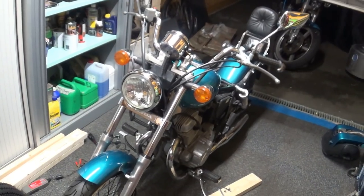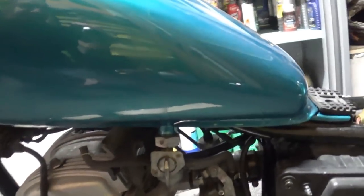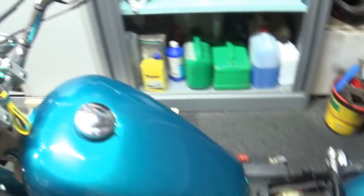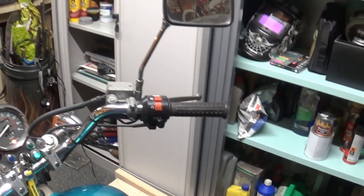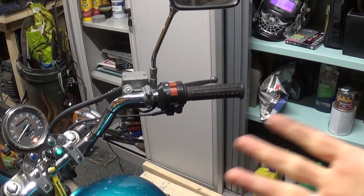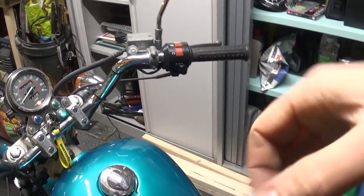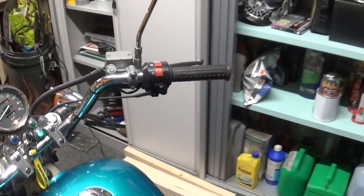I was brave enough and hooked up the original petrol tank with the old — probably four months old — original petrol in it, and it's running okay. You can rev it up just fine when you're gentle, however when I yank on the throttle it just doesn't have quite the same response as with fresh petrol. Once I crack it open suddenly, it just doesn't have the same effect. If I open it slowly, it's absolutely fine.